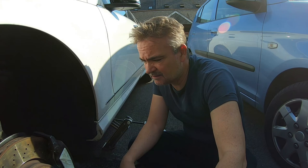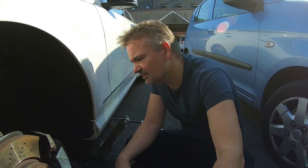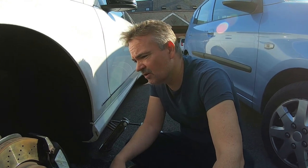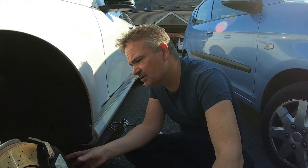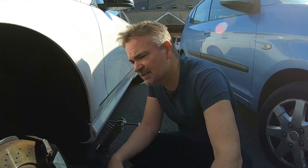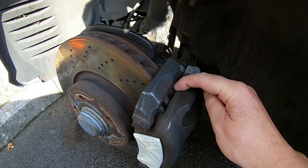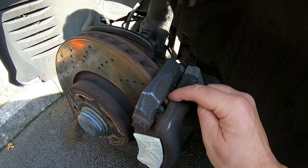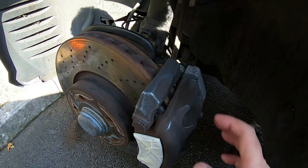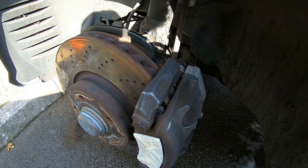This is about preparation — you want to mask up anything so the spray doesn't hit the discs and other parts of the brakes. I can see straight away there are two main areas: the disc itself. The spray is going to go straight through to the disc so I'm just going to put some masking tape from here straight down to mask it. The tape is quite wide which helps.